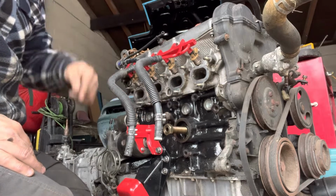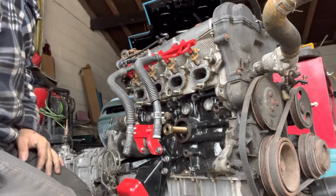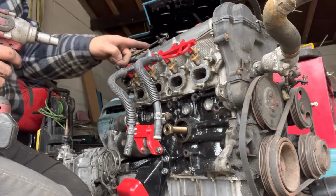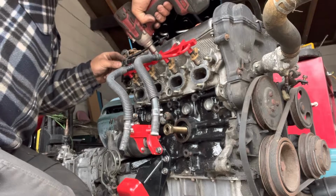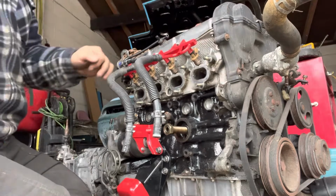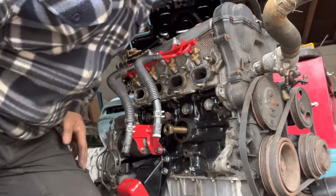Okay, so the bit that you just missed with the video is you just push the injectors in, you put the little black rubber grommets at the top, and the fuel rail just gets pushed over the injectors. Now, you don't have to do it this way, but I always do it. There's only 3 bolts, one there, and there. I do the middle one first. And that pushes the injectors in, so they're nice and tight now.